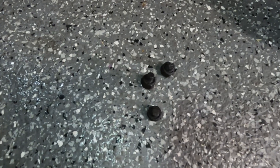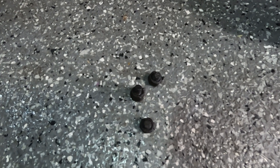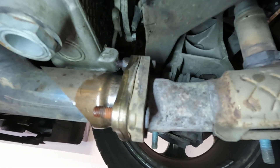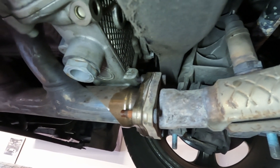My light has given up as soon as I started work. The next step is to take off the exhaust, and as you can see this didn't go too well. On the passenger side, all three bolts on the exhaust snapped. On the driver's side, two came off, but somewhat strangely on this side there is a captive nut welded on and a bolt that goes through — and of course that won't budge and it's a bugger to get to.